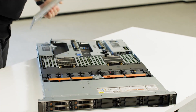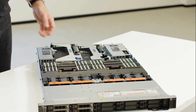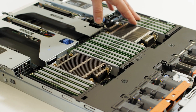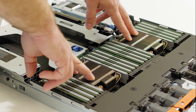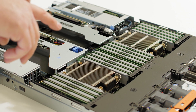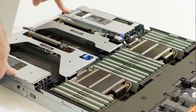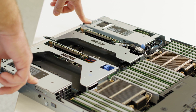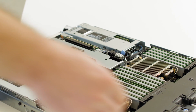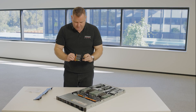So we've taken off the cover. At the front we've got the high-performance fans. Through the middle we've got the 32 DIMM slots for RAM, and the two CPU slots. With the 4th generation Intel scalable processors you can go up to 56 cores per CPU, which is pretty impressive — they're starting to catch up to AMD. And then you've got your two power supplies at the back, fully redundant. Everything's easily toollessly changeable inside — here we've got the heat shroud, which you can remove very easily to access the fans.